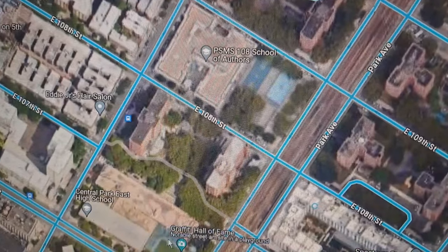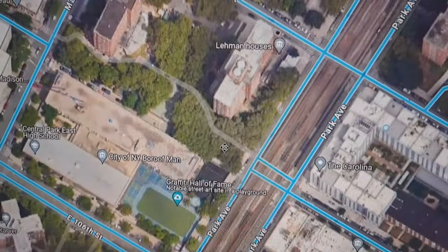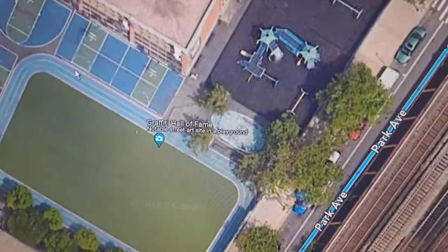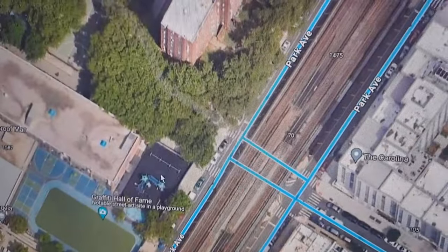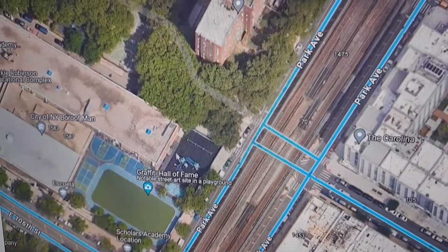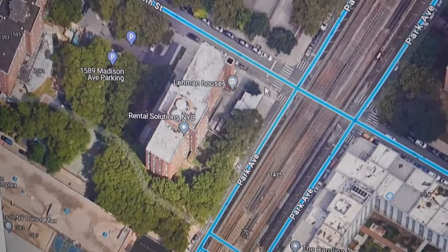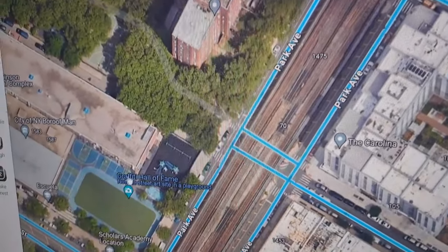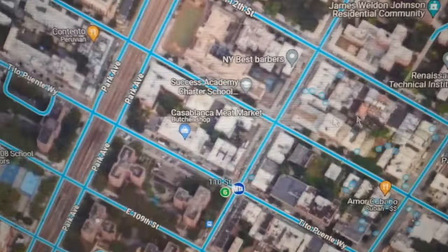If you're standing at a basketball court, you might be able to coast around nearby buildings, but once you go further you're adding more obstruction in every direction. You might be able to cover maybe a block radius. Getting into specifics — if you want to hit a particular track, figure out which path puts only trees between you and the car vs. stacking a building plus trees. Parking closer and taking a shorter path through buildings might work, whereas being farther away with multiple obstructions might not. You really have to understand the layout to predict how your signal will hold up.